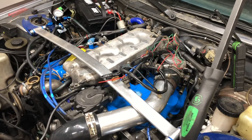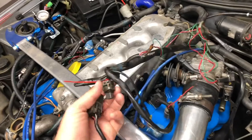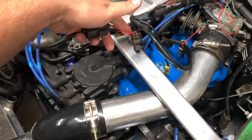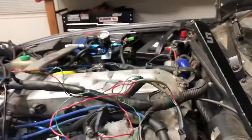So how do you blow a fusible link? Well, I was letting the wiring harness down and just figured I'd start plugging things in, and I actually ended up plugging in the CAS to the idle air control valve connector. Apparently it's the same connector and I wasn't really thinking or looking, and I was like, oh well that looks close enough, and plugged it in on the driver's side of the harness when in reality it goes over to the passenger side. Then I was trying to turn the ignition on and jump the starter switch to see if I get oil pressure, and the fusible link blew.